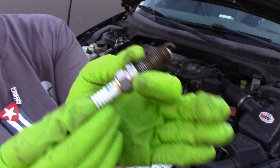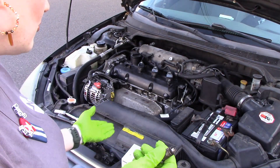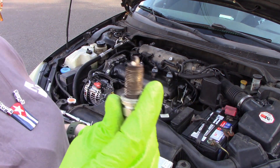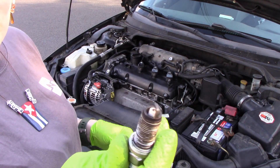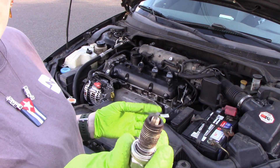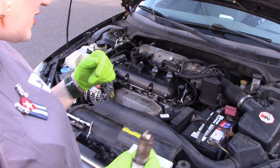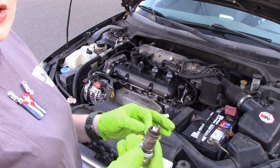These shall last close to 100,000 miles. So if I put one of the NGKs that are not exactly iridium, you're going to have uneven wear. I'd rather put this back in. I'm going to use a torch — this plug is a bit fouled out, so I'll use a torch and blow off all the excess fuel. This will also help cook off any of the impurities on there, and I'll reuse this — only because it's iridium and I hate to have everything uneven. So that's the process here.